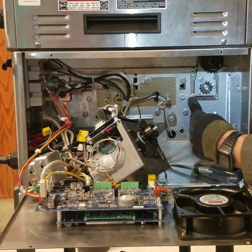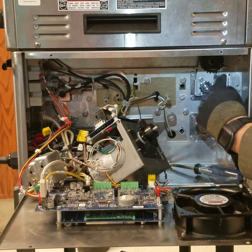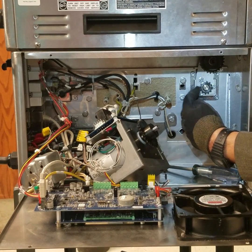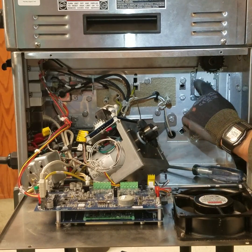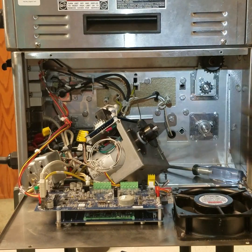Verify that the mounting bracket is flush with the firewall and that there are no gaps around. Also verify these 2 hex nuts to my left are vertically above and below one another, and the word top appears etched on the idler bracket.